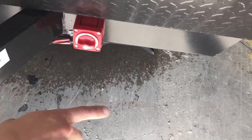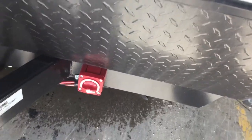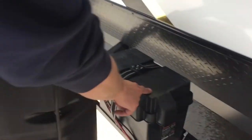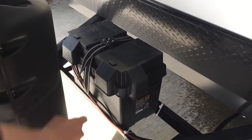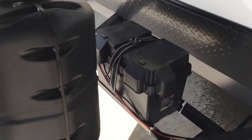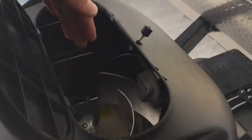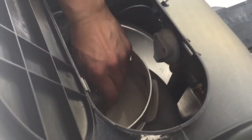A little red box up on the frame is your battery disconnect switch. With it over to the right, that's it turned on; flip it up and pointing up, that's it turned off. Your battery itself is housed inside this box here, and as long as you're plugged in through that cord in the back or your seven-pin to your tow vehicle, that battery is charging. Loosen off this one little knob, push it back, and you get access to your propane tank — just a standard barbecue-style tank. Turn that knob to open it up.